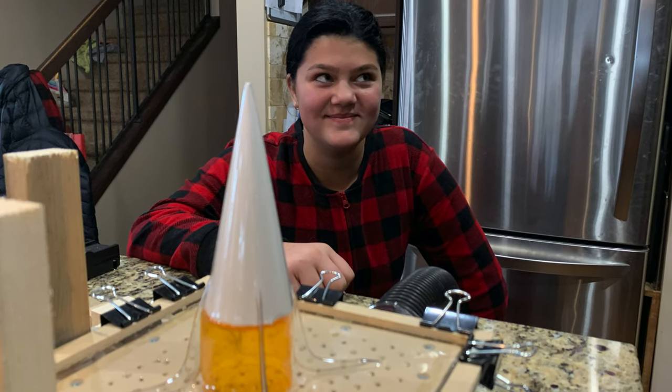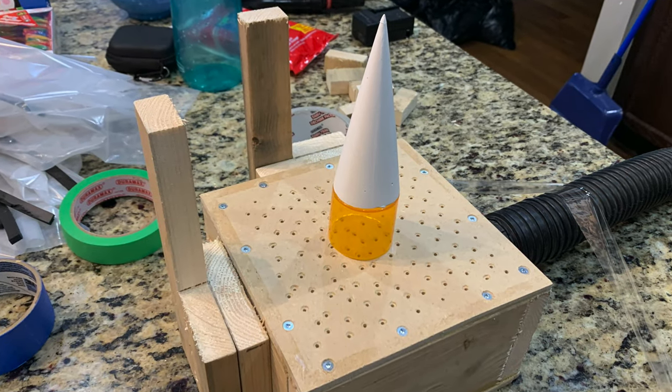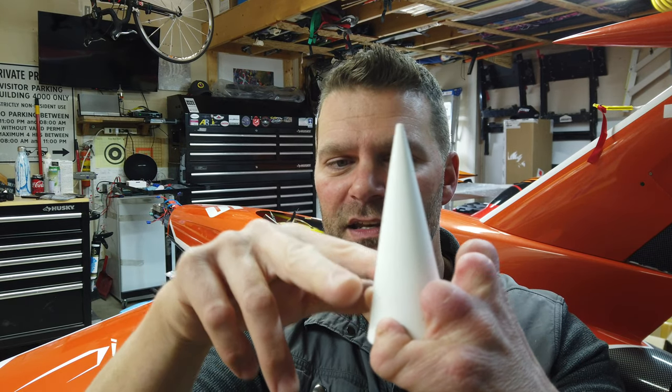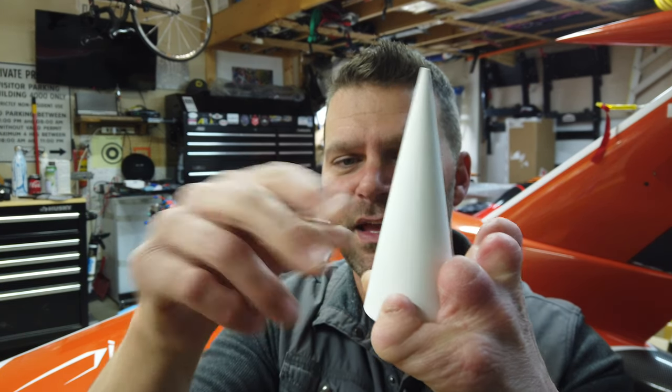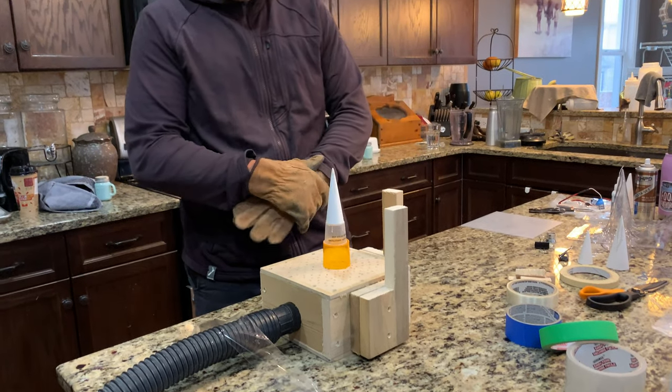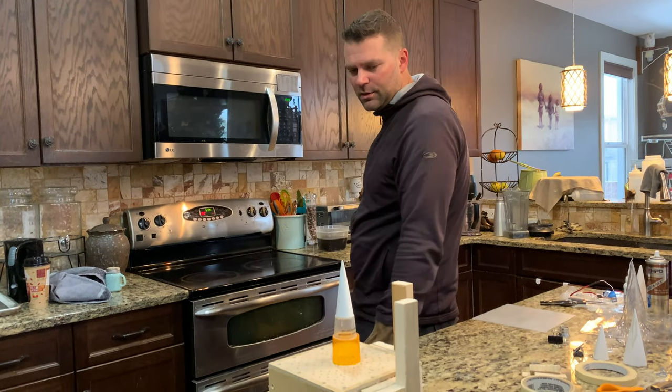I have to give kudos to my daughter Vienna — she's my youngest, the most like me, and has an absolutely brilliant mind. She came up with the solution of putting risers underneath the cones to get rid of the webbing. I kept getting webbing starting partway down that didn't give me enough usable area — I needed the good space lower down. She drew a diagram, we tried it, it worked first try. This time we've added the orange riser on the bottom, and we'll be a little quicker so we don't lose heat on the plastic.